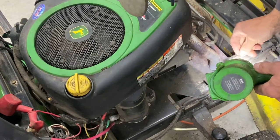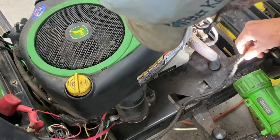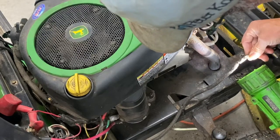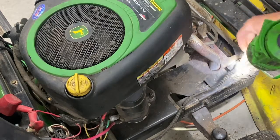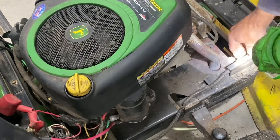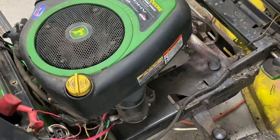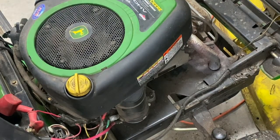These wires go to the headlights, and I don't like that — that should be attached here. Whoa, look at that. That's melted, and those are exposed wires right there. I think we found the problem. That's rubbing inside here against the muffler. When the hood is closed, it shorts out the two cables. When they shut the switch off, it puts the lights on instantly for a quarter of a second — and boom, there goes your fuse.